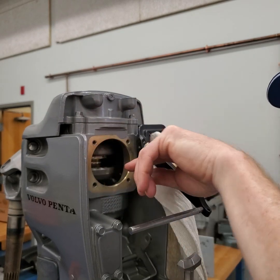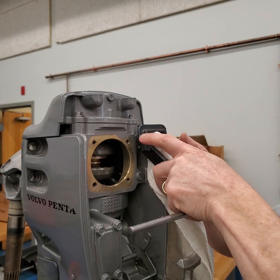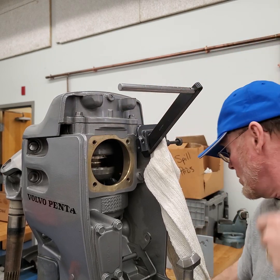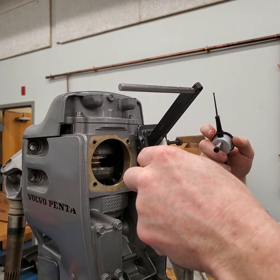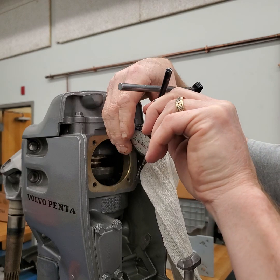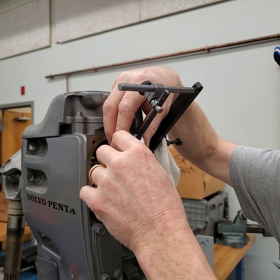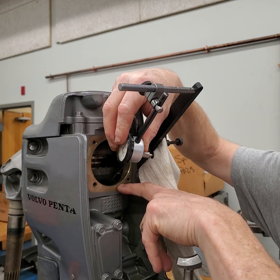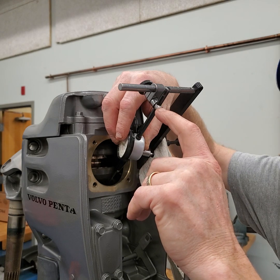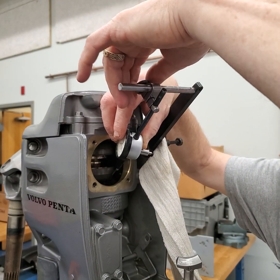The first thing I want to do is measure the lower gear, which is the forward gear. If I put my finger in there you can hear the gear lash. I need to put this adapter on there, so I'm going to loosen this up and raise it up because I need to go down into the gear. One end has a hole and it grabs. I'm going to slide it over and put it halfway up the gear tooth — bottom out, come up to the top, get an estimate of how far in that is — then just lightly preload it so you can snug this up.